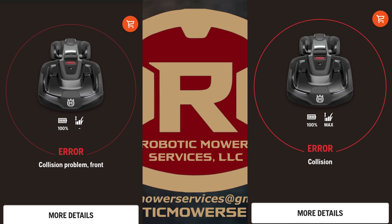Today we're going to talk about the collision active error messages that happen with the 435x and 535 AWD automowers. These are the ones that happen consistently — the mower will be sitting out in the middle of an open area, hasn't hit anything. You check it, the top cover is snapped down securely onto the joysticks, nothing jamming up in the mower to cause this collision active to happen. You restart the mower, off it goes, and before you know it you're getting a collision error again.